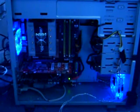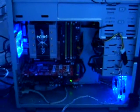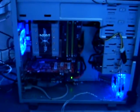Now my theory is that because it's a little bit restricted where you've got the hard drive base here and then your graphics card there, not a lot of that air is making it up into the rest of the case. So I'm trying this and my temperatures look pretty stable, so we'll see how it goes. I've got two 120mm fans on the door panel here, both drawing air in as well. So in total that's 4 fans all drawing air in.